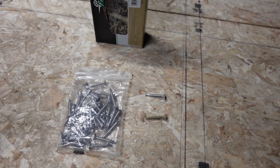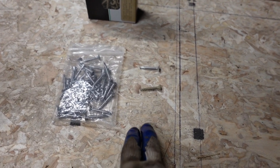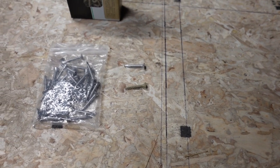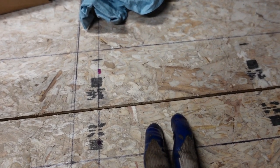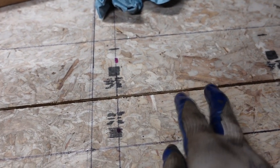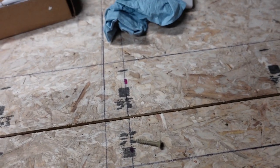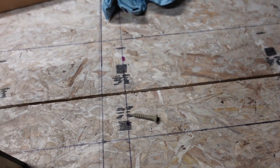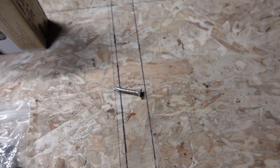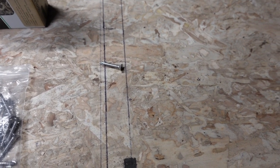I'm working on the floor still - mounting the floor here to the subfloor. We have both one-inch square aluminum and two by six, with the two by six planed down to one inch. Where the wood is, we will use a treated wood screw or outdoor decking screw. Then a stainless self-tapping screw where it goes into the aluminum. For the aluminum, we'll pre-drill a hole and then put that in.